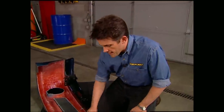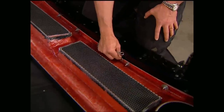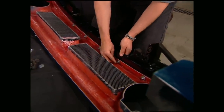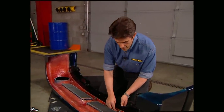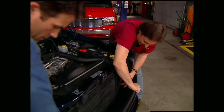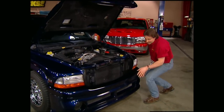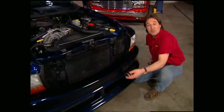With all the drilling out of the way, we need to bolt these two pieces back together. Whatever you do, make sure to use a big flat support washer up against the fiberglass. This is going to help spread the load out so you don't crack the fiberglass or pull the bolt head through. Also, be real careful not to over-tighten things here. Keep in mind an air dam isn't just for looks — they were originally designed to reduce the airflow and turbulence under the vehicle to give you better aerodynamics.